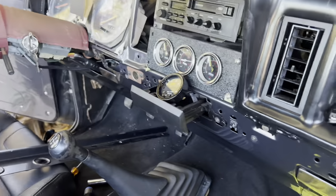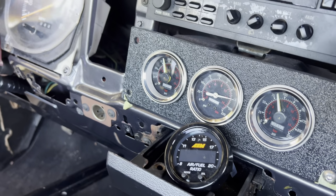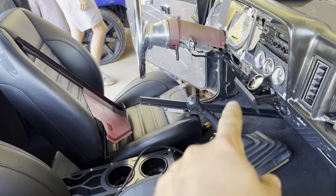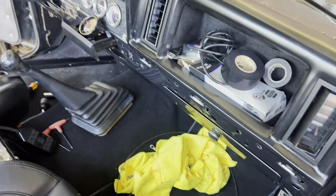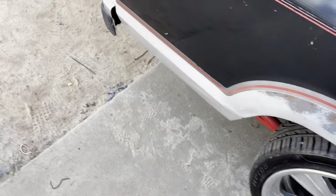All right, we got the gauges hooked up. We got the air mains hooked up. 175 PSI pressure switch. We got them all plumbed. Chandler is running the pink power wire for the switch box over there now. And we've got a wire right here that is for the relay for the compressors. We're going to mount a switch in the dash. But it's wired and plumbed now. Everything except those two wires. So it's on air right here for the first time ever.